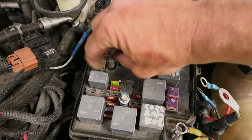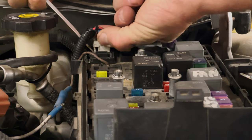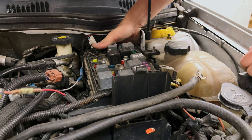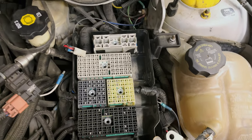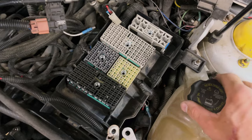These little bolts here don't actually hold down the fuse box — they actually thread into electrical connectors underneath. This power steering plug here, you just push in on this connector; they've got little snaps here, here, and one back here, one up on this corner. That's the top of your electrical box — just a bunch of pins that go right into your connectors down there. These electrical connectors basically just sit in this plastic housing, and before we remove those we need to get this plastic housing loose.